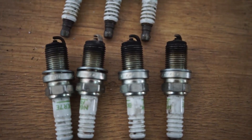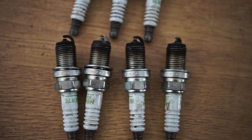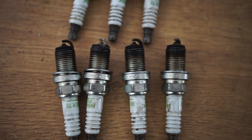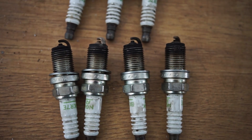They sometimes also stick open, which is something you really don't want because that can actually lock up your engine and damage it badly. In this case, one cylinder was running quite a bit leaner, and it's good that I did not go full throttle for a long pull, because that might have actually done damage to my engine.